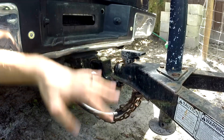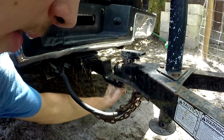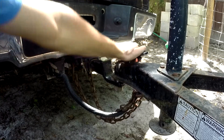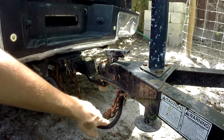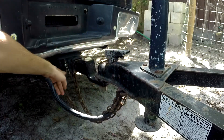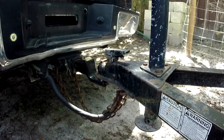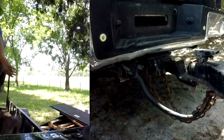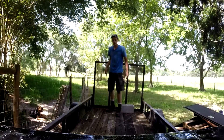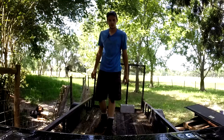That's how you hook it up. Now go through and double-check that everything is secured. Make sure the nut on the bottom is good and tight. Just give everything a good shake to make sure nothing is loose. Double-check your chains, your wire, your pins, and your lever. Make sure the ball is seated fully, your security pin is secure, and double-check your light connection. The best way to make sure the trailer is secure: once you've checked the connections, just come back here and give a couple of bounces — that will tell you if it's good and secure.